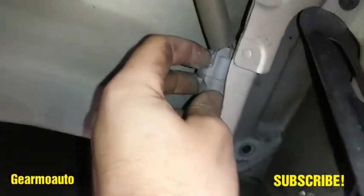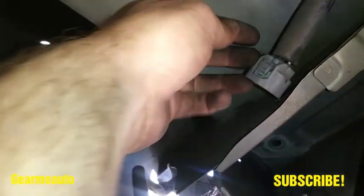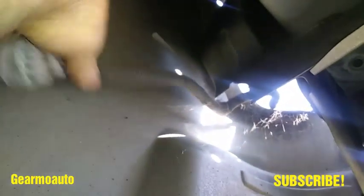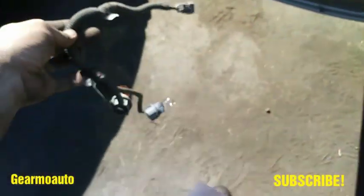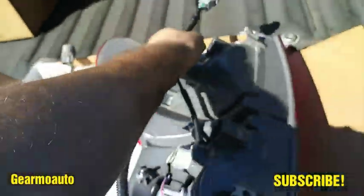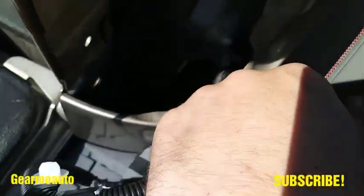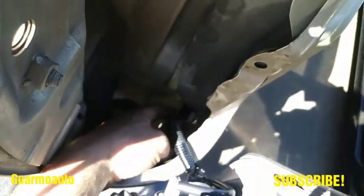You can reach up. You could pull it off the little wall right there to get more leverage on it, but disconnect this. It was kind of tight because some dirt and stuff gets in there over time. You push on the little tab button, and then I went and removed everything that was attached to the harness, pulled it out. Now my new one's all assembled, so I'm just going to run the harness down the hole, and watch out for spiders too while you're doing this. Run this down the hole, and then I connect it right here.